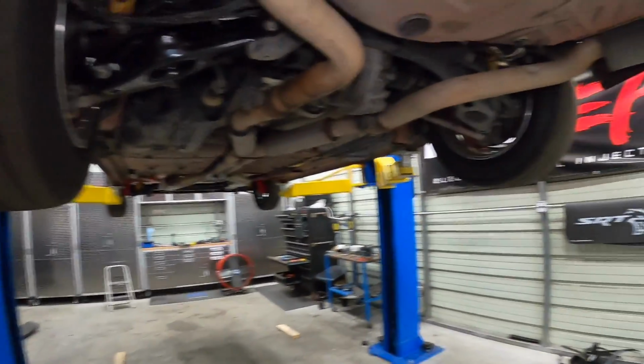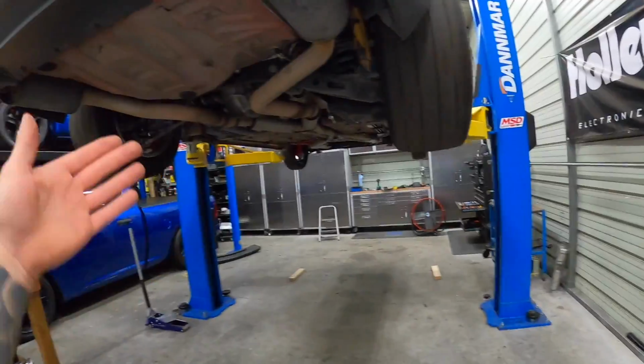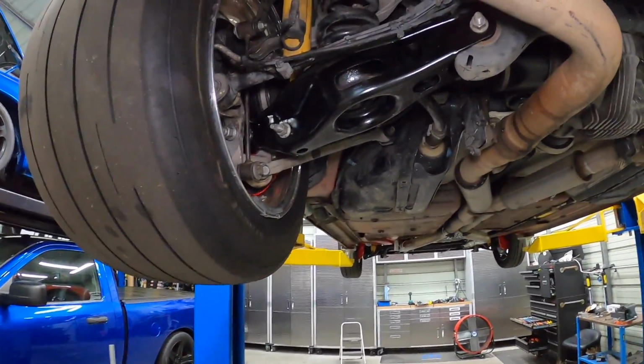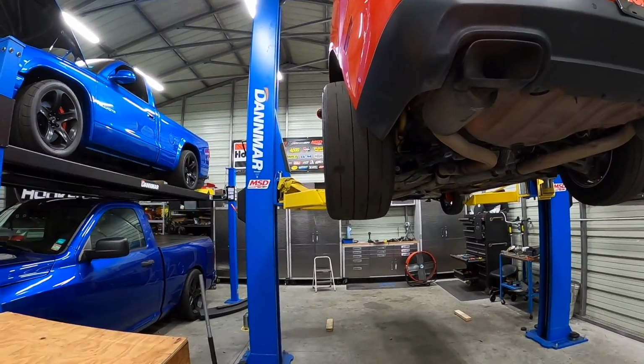We can also actually throw our toe plates on the back here and just check quickly whether it's just an illusion or whether it's actually in like I think. Before I touch it, let's put it down, check it, and then I'll see if I'm crazy or not. But this one, for whatever reason, to me appears just a tiny bit toe in.